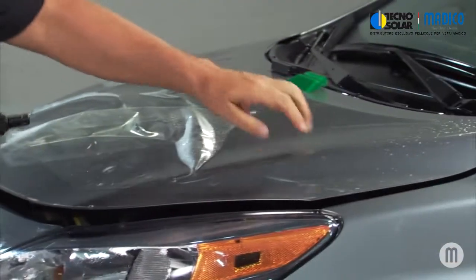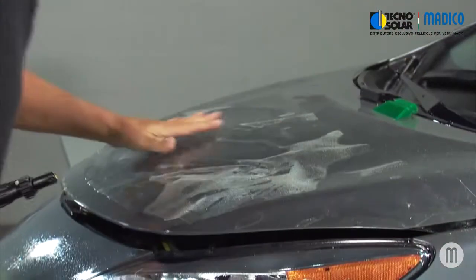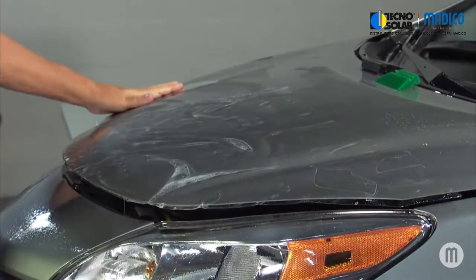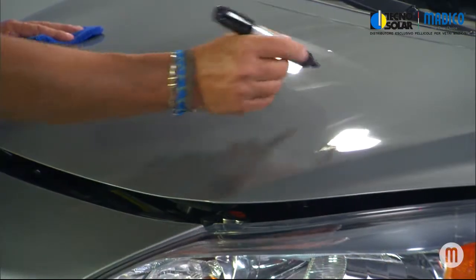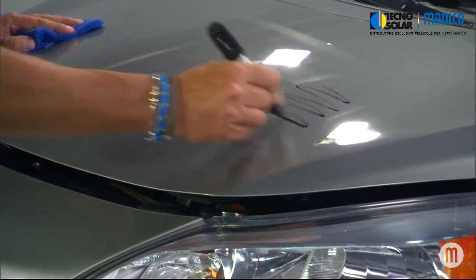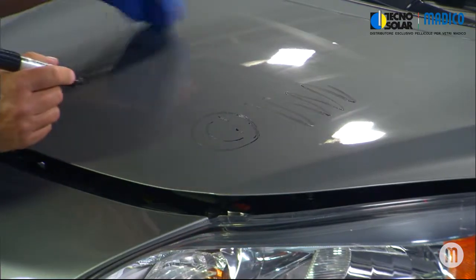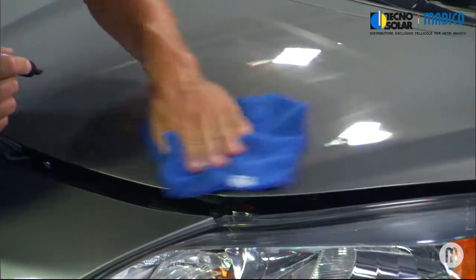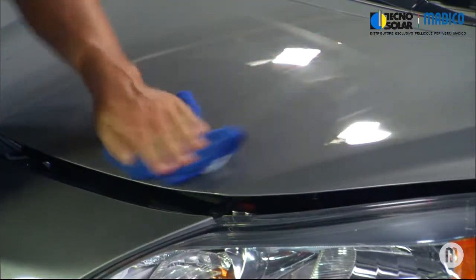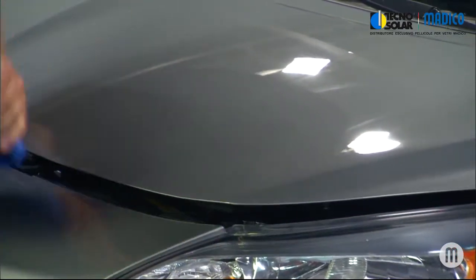Protekt PPF offers exceptional chemical and residue resistance. Solvents such as acetone, gasoline, and motor oil will not damage the film when left on for short durations of time. Protekt PPF also resists staining from natural substances like bird droppings and bug residue. Even a permanent marker will not stain or mark the film surface. All residue can usually be cleaned with a soft cloth and the water and baby shampoo solution. If needed, alcohol can also be used to achieve a complete removal of these substances.